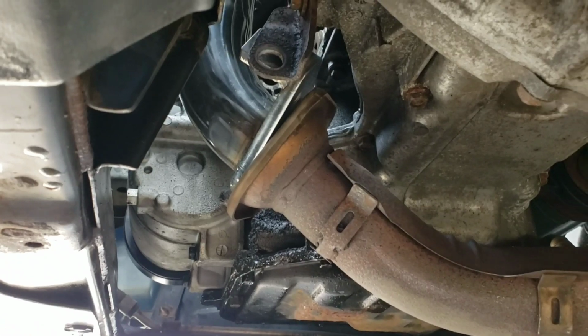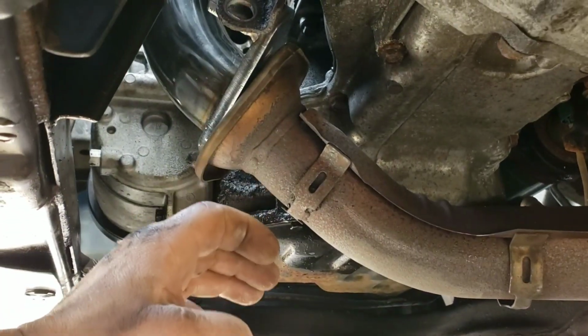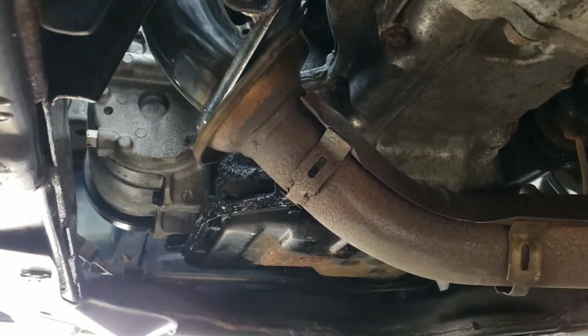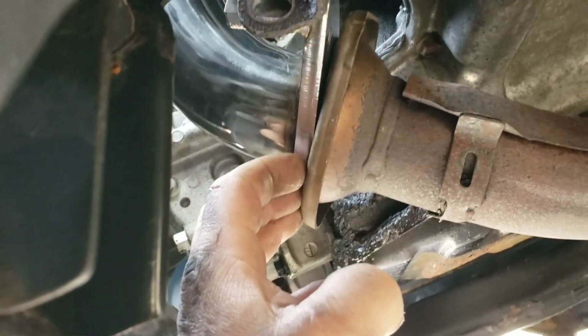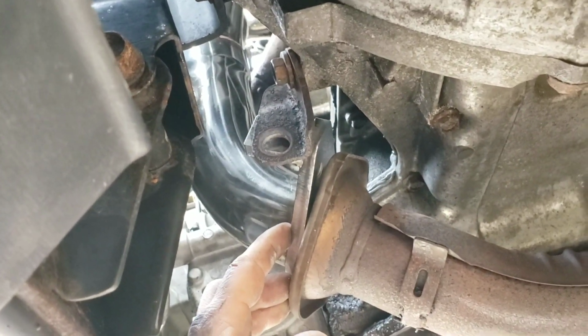Yay, more problems. Alright, look at this wonderfulness. So my downpipe here was down here, so I had to slide it over the lip that comes off the header that the donut gasket goes on, right? It's all I could do to get it over that and slam on there. It's smashed all the way against this. Basically this header's too long.